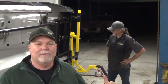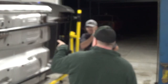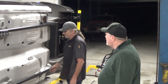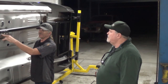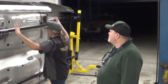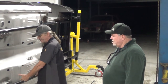Okay, so Damon got our subframe connectors installed on the 67 Ford Mustang GT500. Damon, you got these subframe connectors in, so where are we at with it right now? So when we started out, we had ground all of the primers smooth, and the surfaces where we were going to weld the subframe connector to the subframes. We had the upper one all clamped and finished welded when we started to show you this lower one. We had it tacked in place.